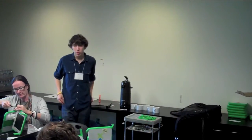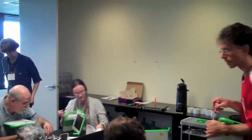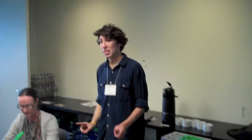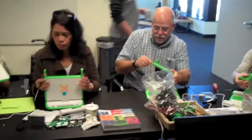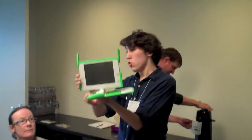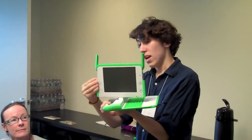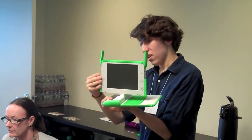When most of you have finished removing those screws, I'll show you how to pop everything apart. After you've removed the four screws, flip the antennas so they're facing straight up. Then you have two pieces of green plastic on either side of the screen — those slide up just a little bit and then straight out. So it's up and then straight out, and you want to remove both pieces.